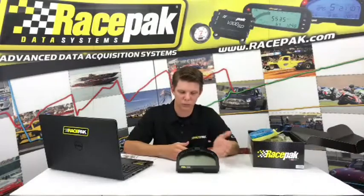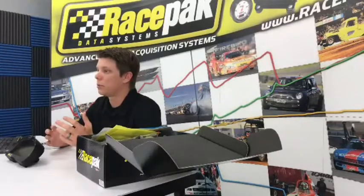What I do on my cars is I have the data logger start to record off of a certain engine RPM. With my car being a Super Comp car, and I drive it to the staging lanes and on and off and pulling it up and whatnot, I don't want to write a recording every single time I do that. So I make sure that I put the value at something that I'm not going to hit driving through the lanes. What I do is I put it on my burnout rev limiter, which is actually 6,400 in my car.